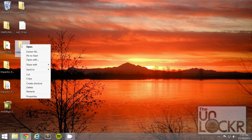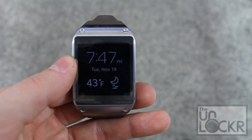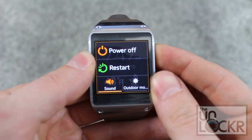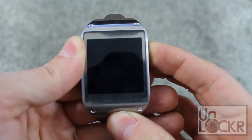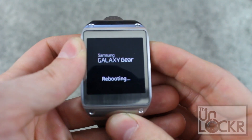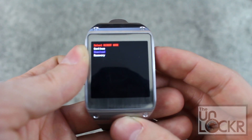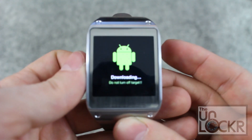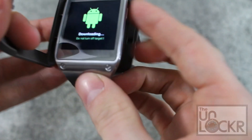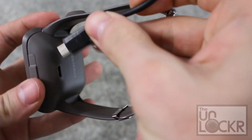Then, right-click the Odin folder once that's done and hit Extract All, hit Extract, and double-click the .exe file and hit Yes to open that up. Then, we're going to put it into download mode by holding down the power button. Keep holding it until rebooting comes up on the screen, then let go. As soon as we let go, we're going to tap the power button five times and it should give us this screen. Tap the power button once more to get to download, then tap and hold it for three seconds and let go, and it should put you into download mode. When that happens, we can put it into the charging case and plug it into the computer by USB.